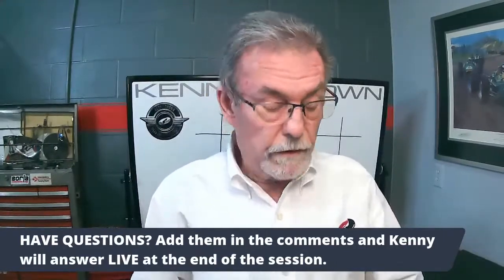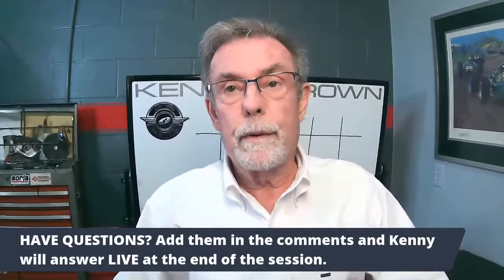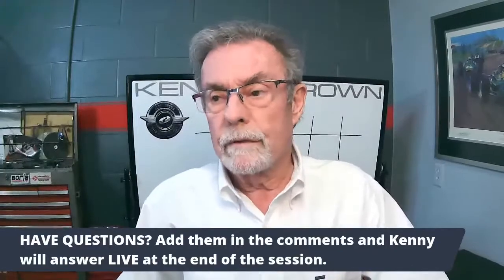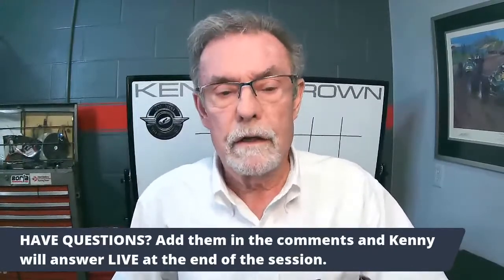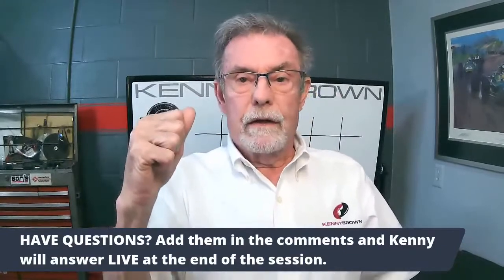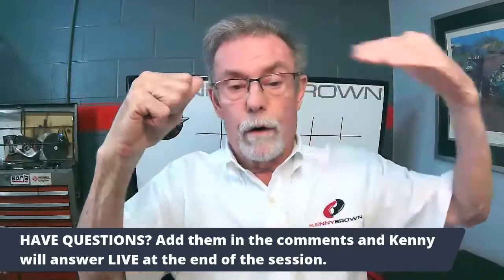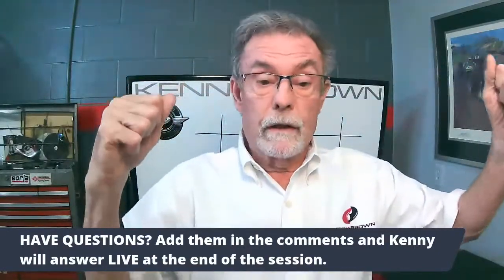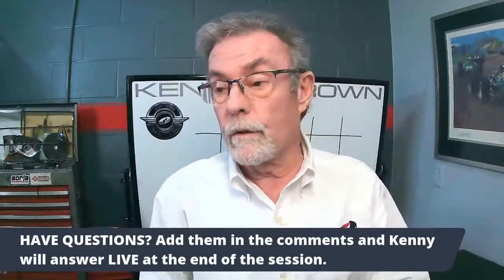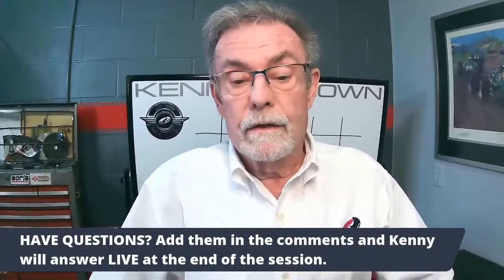Don't listen to internet experts. They have no idea what they're talking about for the most part. The problem with people on the internet is they don't know what they don't know. But it just makes sense. If you've got loads going into one shock tower or strut tower, it's going to push it up and down. But if you had a brace from there over to the other one, all of a sudden they're going to be sharing the load. And that's like half the load going into each, so that car will handle better. And you get better tire wear, and the line will stay better.